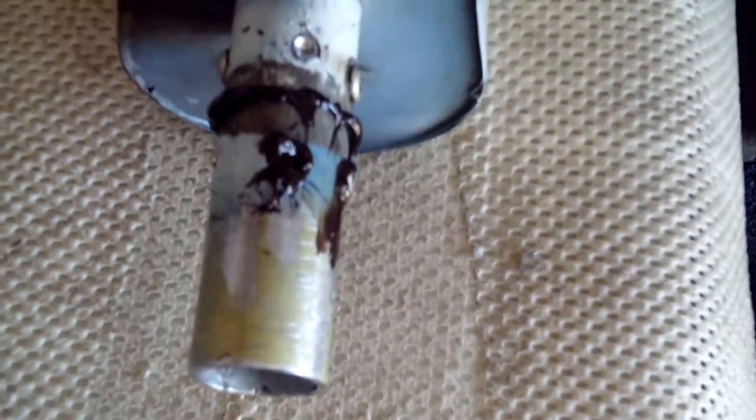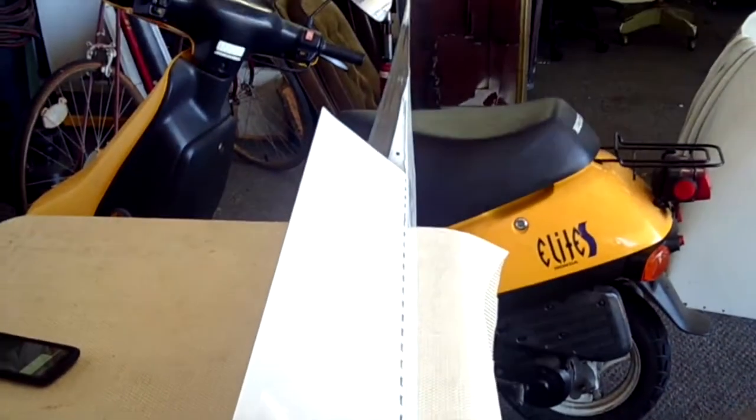We're in the middle of a process here. Basically, this is the elevator off of a Tiger that had a little bit of play in the torque tube down here. So what we've done is we took it all apart. They had already done service kit 144 on it, but they hadn't put enough sealant. So we took it all off and cleaned all the old sealant off.